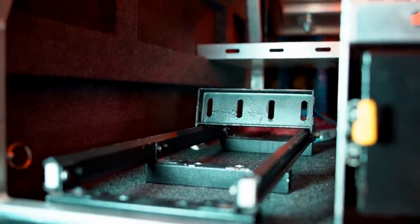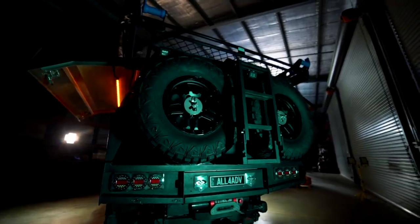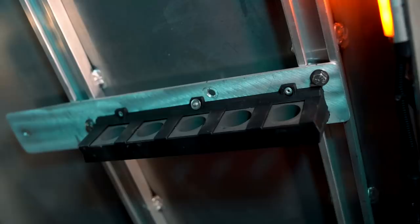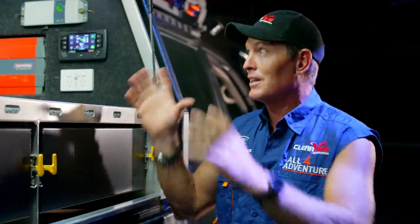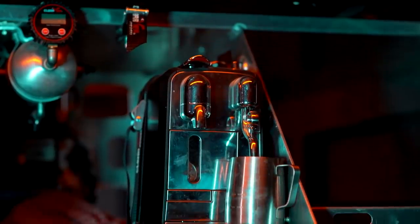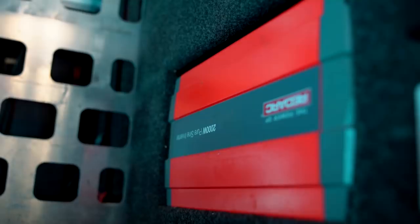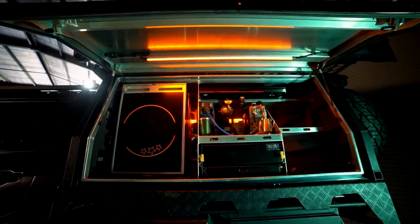Other things in the canopy include an outboard slide holding a 20 horsepower Mercury outboard. There's a boat sitting on the roof with an Elmac boat loader making it easy to get on and off. I've put rod holders inside to protect the fishing rods — travel rods that are three-piece fit really well. On the kitchen side there's a coffee machine, and to run something like that at 240 volts, you need that battery power converted from 12 volt to 240 via a big inverter. I use a 2000 watt inverter, which covers those little luxuries.